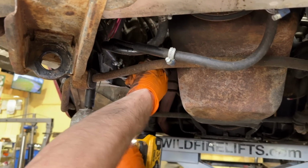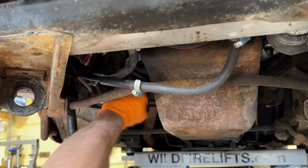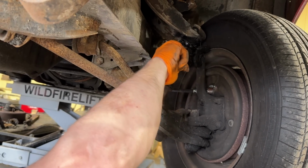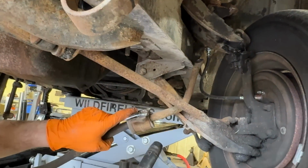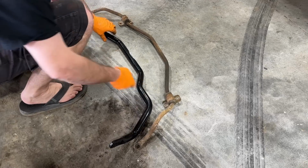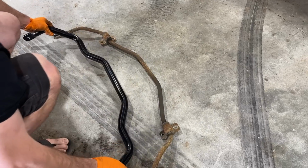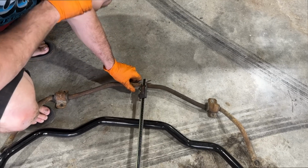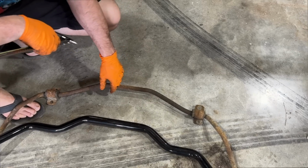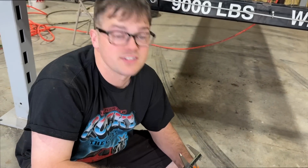It's spinning, buddy. That seems so puny. It's very small. We'll compare it to the new one. Take the whole front sway bar out of the way. There's that guy. I would think this would be optional back then because a lot of cars didn't have sway bars back then. That's a crazy difference in that, huh? It looks like it goes up out of the way. I was worried about that because this is really close to our oil pan here. 0.73, so it's a little less than 3/4 of an inch. And this guy is 1.26, so 1.25 inches. Crazy. Yeah, it looks like it's double as big, doesn't it? Yeah. That's what controls your body roll, like how much of this you have, which we have a ton of that.